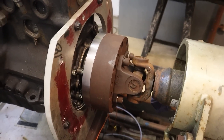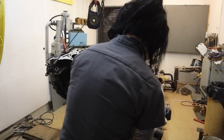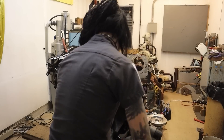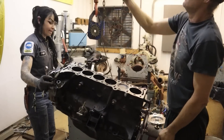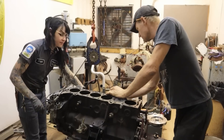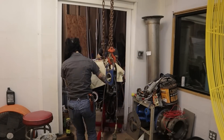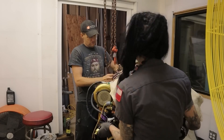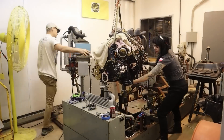I found a local machinist to make me that custom adapter plate that bolts to the 7M as well as to the dyno driveshaft. It has to be extremely precise and balanced. I brought him a spare crankshaft so he could machine the bolt holes for the engine side, and I brought him another engine adapter from the dyno so that he could machine the holes perfectly for the dyno side and cut threads for the bolts that we use. Now that we have our mounts adjusted and we know our driveshaft is going to fit with the adapter, it's time to put my engine on the dyno stand.